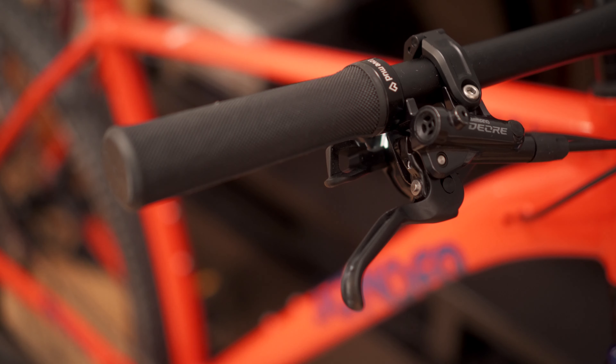You can see I've got the Deore brake levers and the Deore 12-speed shifters — that's all the M6100 stuff, 12-speed. Really, really nice. Really good that they come already set up with the iSpec EV clamp, which makes it really nice and tidy on the bars. I did have to adjust the reach on the levers — I've got pretty big hands, so I had to adjust the levers all the way out. You do have to use an Allen key for that with the Deore levers, whereas with SLX, XT, or XTR there's a little dial. But it was pretty quick — basically just wind it all the way out to get maximum reach. Once I get the new grips on, I'll start fine-tuning the positions.